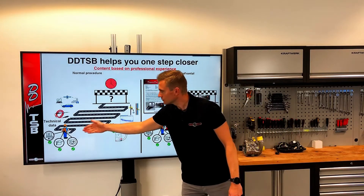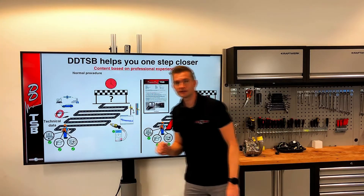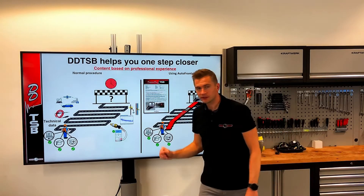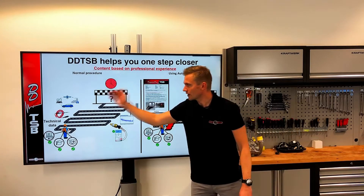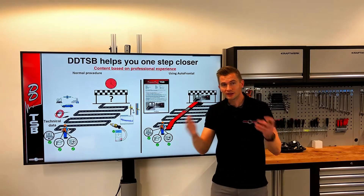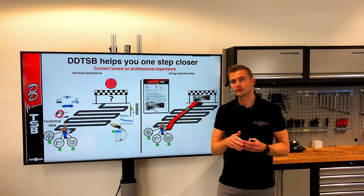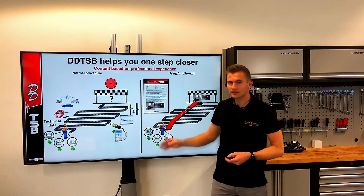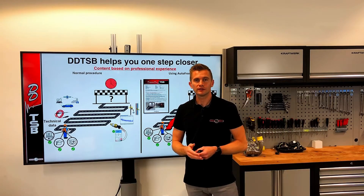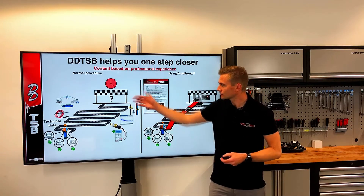Without a TSB, we need to start our diagnosis from the beginning. If we have no experience of the problem on the selected car, we need to find the technical data so we can measure the resistance in the temperature sensor. If the resistance is within specification, we then proceed to check the wiring — checking power and ground, also with load on. If we still haven't revealed the fault, we proceed with the oscilloscope, perhaps taking the car for a test drive or doing a wiggle test. If the car is one to four years old, we also need to consider whether a control unit software update could solve the problem.